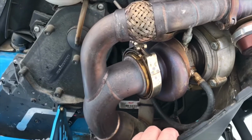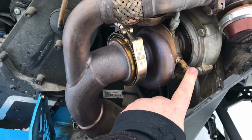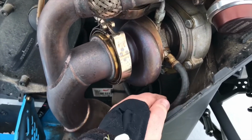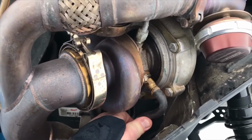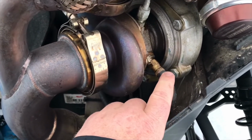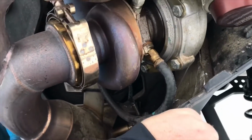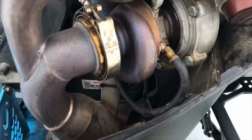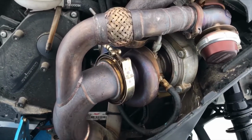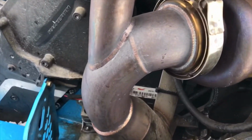The biggest thing, Silber, if you're watching this, put a 90-degree angle on that hose. For the love of God, this is ridiculous. That should have a 90 on it, so it's like this and not pushing out, because that is getting so hot, and there's stress on that when my side panel gets pushed in, when I'm side hilling or hitting rocks, whatever the case may be. Please do something about that, Silber. I know you're going to watch this, Justin Silber.